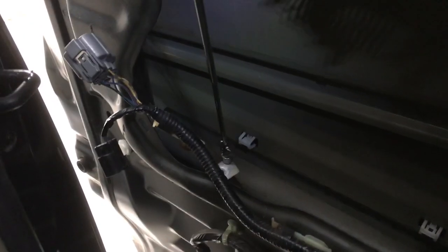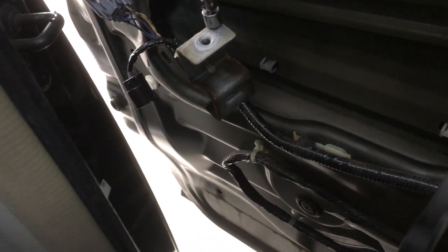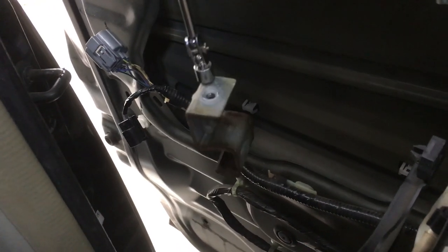I will give you a piece of advice. There is a metal bracket on the bottom of the power window track and if you bump that too much it's going to fall off down inside your door. You need something with a magnet to get it out because you can't reach it with your bare hands. So beware — this bracket does separate.